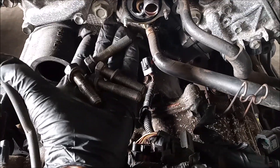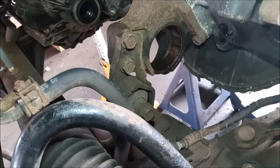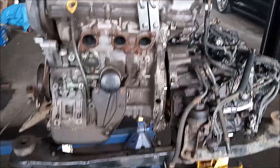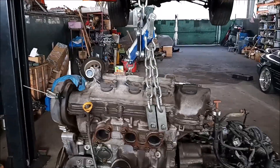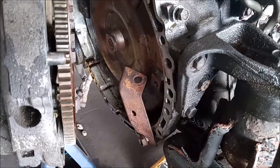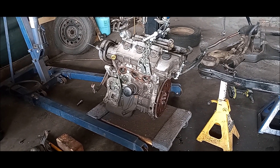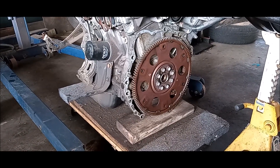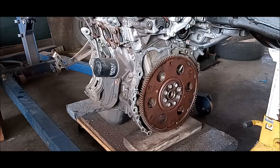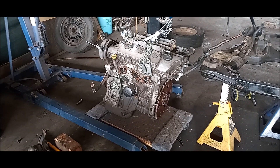Remove the engine mounts — there is one on the passenger side and one on the rear. This engine mount needs to come out completely. The engine is separated from the transmission, supported by the crane, and we can just pull it out. I put a random bracket with a bolt on here so the torque converter does not fall out. I've set it down on a little dolly, and there it is — it's all out. If you place a 2x4 underneath the bell housing flange, the engine will be well supported and well balanced. Now installation is the reverse of removal, right? Thank you for watching this video. I hope you found it interesting.